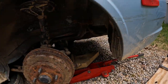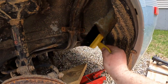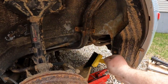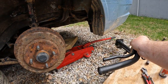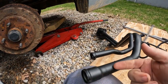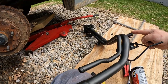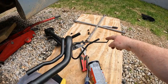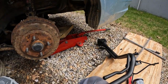The next step is to come in here with a little brush and try to clean some of the loose stuff up, because I'm about to have to take apart a whole bunch of connections. You can see on the new part: here is one where the fuel goes, and here is one of the — I'm not sure if this is a vacuum line or what that's called — and another one. So there's one, two small ones, one, two medium ones, and then one large one for the fuel.